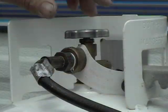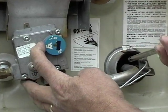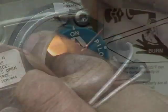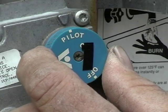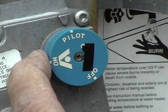Make sure that the propane is on. To light the pilot light, you should have a striker or lighter like this one — it makes lighting a lot easier. Always light the striker first. If your control looks like this one, turn the dial to pilot. Notice it's spring-loaded. Put the lighter into the burn tube and turn beyond the spring. When the pilot lights, remove the lighter and hold the pilot switch for about 30 seconds.